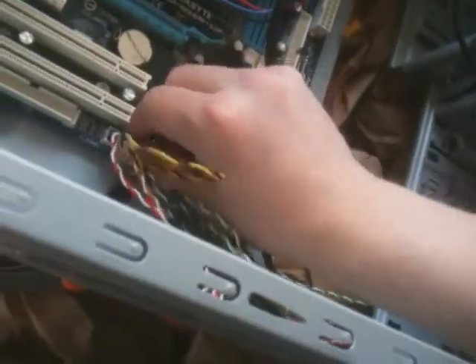Alright, now we have to unplug everything — unplug the audio headers from the board, unplug the CPU fan, unplug the power for the entire thing, which is a little bit of a wrestling match. Big old power connector right there. Unplug the connectors from the DVD drives. Let the floppy cable out of the way as well. We just grab all these wires, pull them out of the way, get this IDE cable out of here, and now we have access to the board. Take the front USB headers off, and of course the stuff for the PC speaker, reset button, power button, et cetera.